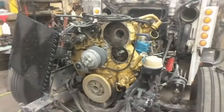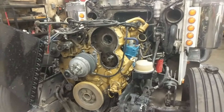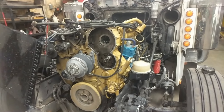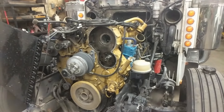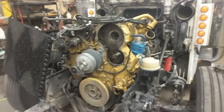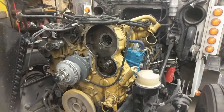The quality here isn't great, but you can see he now has a shaved pan where they cut out that plug — so he doesn't have a front drain, which isn't really necessary in the first place. This is a BXS out of an '04 Peterbilt, and the way they position that engine in the truck, that drain comes right down on top of that axle.